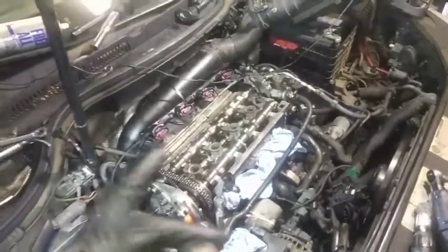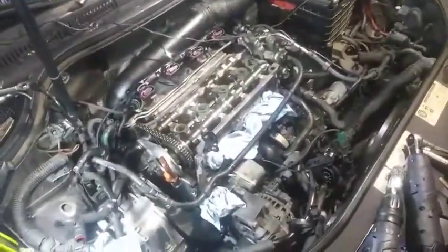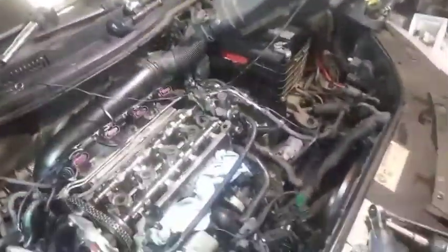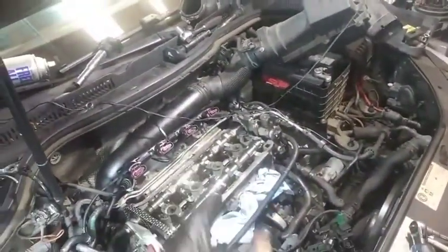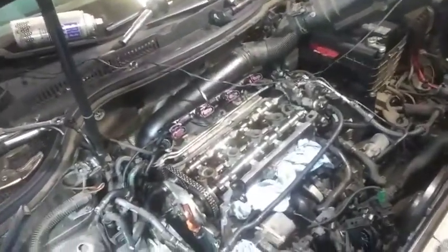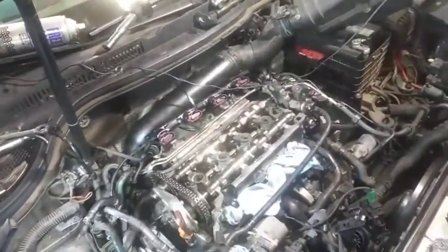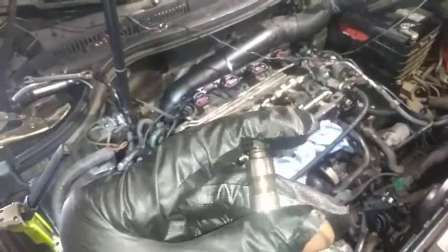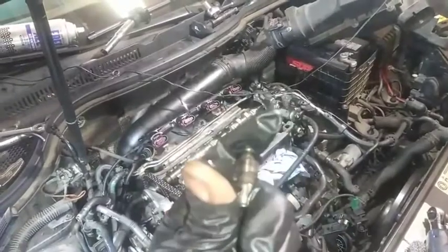Today is the next day. I had to go to Advance Auto to get the rocker arm ordered. I called this morning so it should be here by now. I'm also replacing this vacuum pump gasket because when I pulled the valve cover off I'm pretty sure I distorted it and I don't feel comfortable putting it back - it's going to leak. This is the cam follower or lifter that I pulled out of the motor. It seemed to be fine - I depressurized it. Pulled another accessible one out, that was working too - depressurized, felt the same. They all feel normal, not damaged.